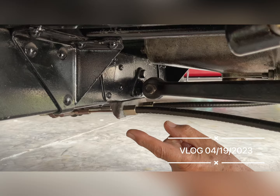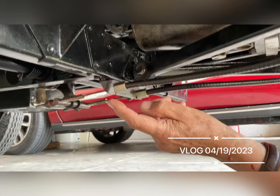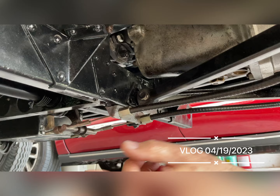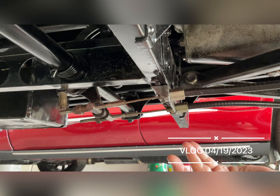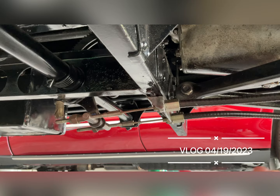The next important thing with the Austin 7 chassis: on this particular car, although it's a 1929 car, it's got all the latest modifications because it was a race car. The four-and-a-half cross member was originally located at the front with just two rivets at the bottom and two rivets at the top on the flange. What I do is take a plate, weld another plate on there so it comes inside and welds through the front of the cross member, and that makes an enormous difference to the stiffness. That modification doesn't show, doesn't impinge on the performance of the vehicle — it improves it dramatically.